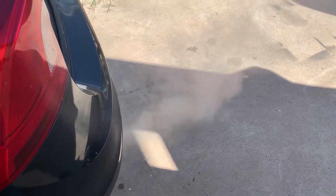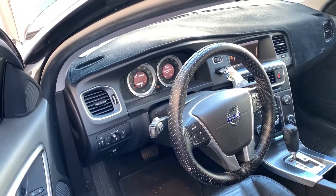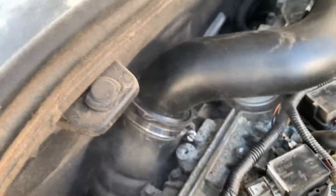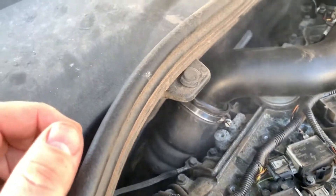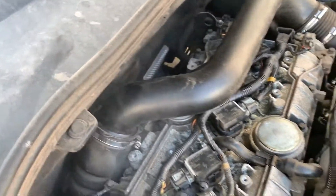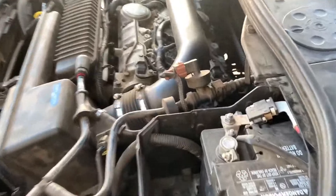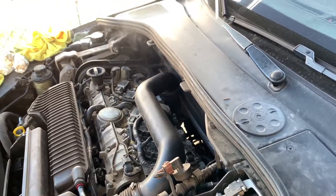It's resumed a nice idle. There's some smoke on the turbo side — it may be burning off some of the extra cleaner. I'm going to keep a careful eye on it. This should help tell me what else is going on with the turbo, because we shouldn't be seeing a lot of smoke back there.